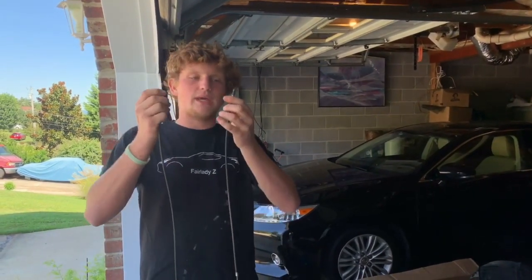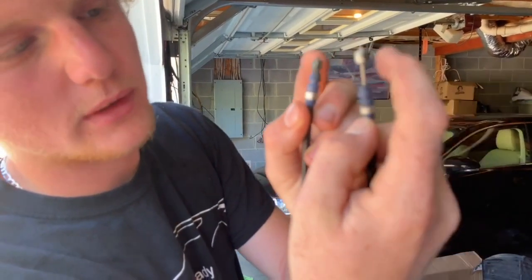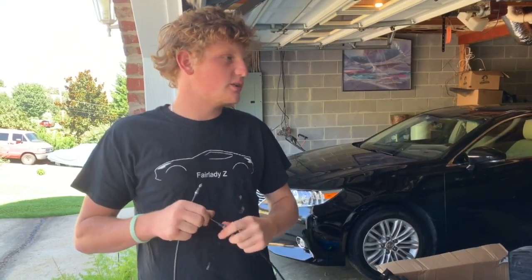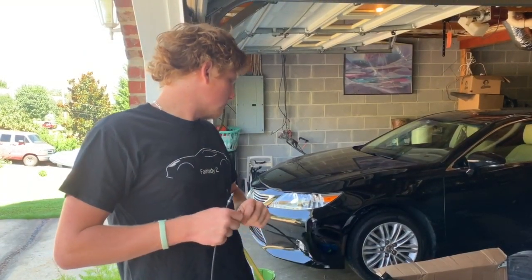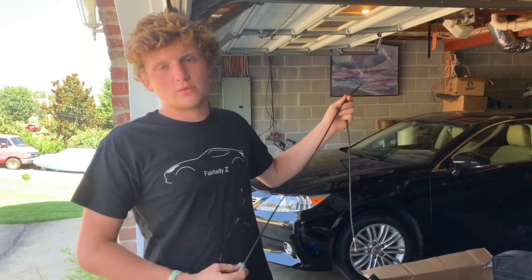We got these two cables over here for the hood because the little hood hinges don't open up, since on the old cables these plastics are broken off. So we got new ones. We're gonna replace this, take the bumper off and fix the hood hinges, adjust the hood, and adjust the fitment. And then we've got a couple of plastics to put back onto the car, just little stuff. And we did get something, went over and picked it up from our buddy Goon Squad's house.